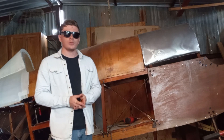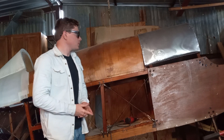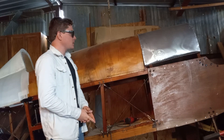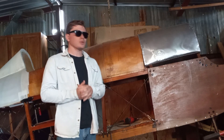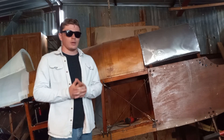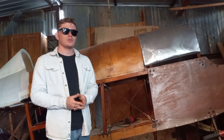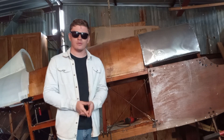Also, an original fuel tank would use solid rivets which are a huge pain to work with, so I cheated and made mine with pop rivets, which don't look quite right but at least it looks better than a welded tank would. Also my tank doesn't have any baffles — I'm planning to use the more modern method of just filling it with a low density foam which will save me a lot of time.